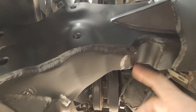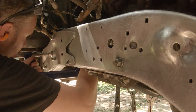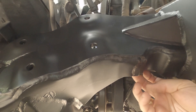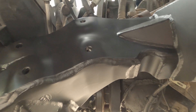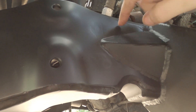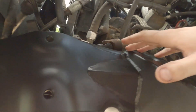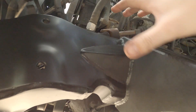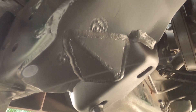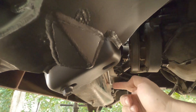Heading to the other side — the steering box brace — I had to make a couple of modifications to account for this scallop. That meant changing the plate here; this plate actually extends all the way over if you leave it alone, so I needed to cut it shy. I welded pretty thoroughly on the inside of the frame here and I'm going to plate the inside to make it a bit stiffer. That's also why I put in this gusset — to beef up what is a shorter section of rail and transfer some loading to the panhard bar, which grabs all the way down to the bottom of the rail. I also added this taco gusset, which is easy to make using cardboard cut into a kite shape. And of course you still reinstall your Off Road Design steering brace, which from the backside of these two holes triangulates all the way down.